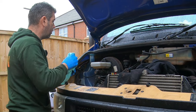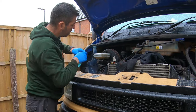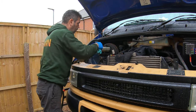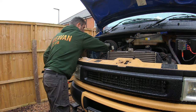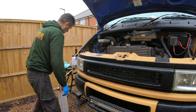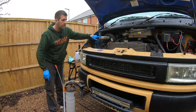I've come to the front end of the van because now is the time to bleed the brakes. What I'm going to use is a pressure bleeder, but the first job I want to do is remove the old oil that's inside the reservoir. So I'm just going to clean the top of the reservoir so I'm not contaminating the contents, and put a rag underneath so I'm not going to spill any brake fluid on the paintwork. And here we have it — my oil extractor.